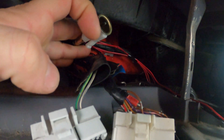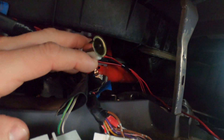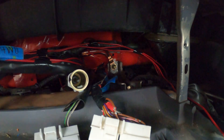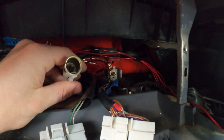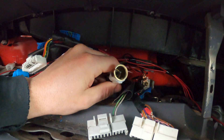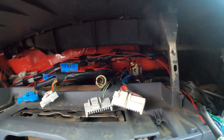The SR5 cluster from your donor vehicle has a different type. Get a flat blade screwdriver — if we're calling this the back of the connector, then this is the front. There'll be a gap on the front of the connector. Slip the flat blade in there and pull down to open the gap, which causes the little plastic tab to go down and release from the speedo. When removing your cluster, you'll remove all the wiring connectors fairly easily but then find the cluster stuck because the speedo cable is still attached — so you have to deal with that first.